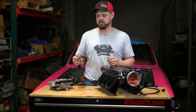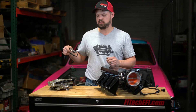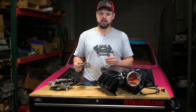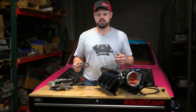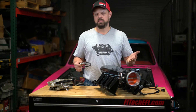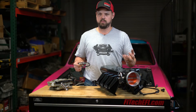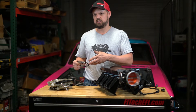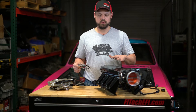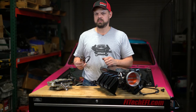The oxygen sensor needs to be in the exhaust without any leaks nearby so that it gets an accurate reading from what's coming out of the engine. If it's too close to an open exhaust pipe, the readings will be skewed. The oxygen sensor reads what's coming out of the engine, but what goes into the engine is based on our sensor readings. If they're messed up — say the MAP sensor is not reading correctly or a coolant sensor is way off — it may actually be injecting the base value incorrectly and using the oxygen sensor to correct for that. Ideally, you want all sensors to read correctly so that everything's working optimally.